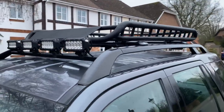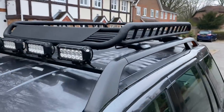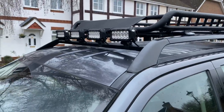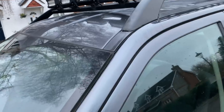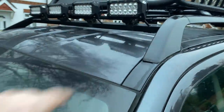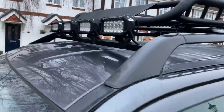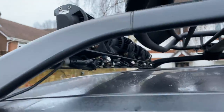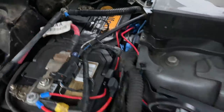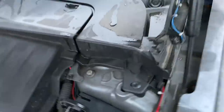We've got four spotlights on the roof rack. I will be changing those four for a 42-inch light bar soon, fitted with new brackets coming from the feet and going straight across. The current angle aluminium that the spots are mounted on will be going. It's wired up and runs down the side of the windscreen down to some relays — one for the roof lights and one for the air horns. I will be tidying that up at some point, putting the relays in a box to keep it all waterproof.